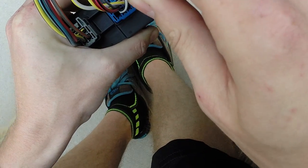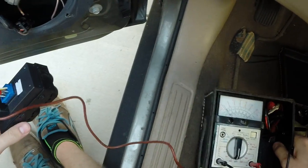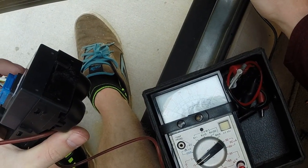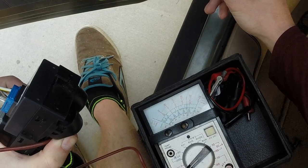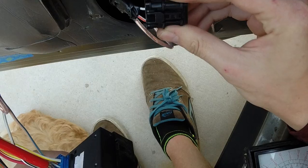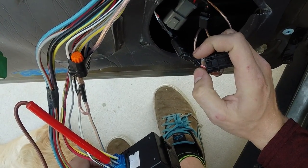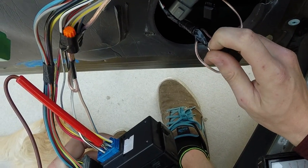I'm going to test this first one right here — put it back up so you can see it, turn it back on, put it on ground, and then push down. Now you can see at the switch we don't have a problem — it's getting all the voltage, not half the voltage. So that means there's an issue with the pigtail connected to your motor. Whenever it tries to switch up, one wire is good but the ground isn't staying. When it switches the other way, this won't turn to ground — it'll have a good ground but the positive won't always stay connected.